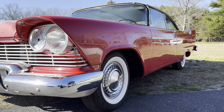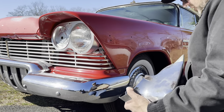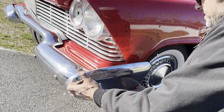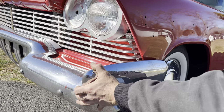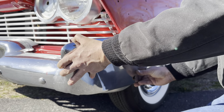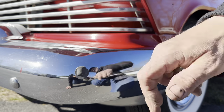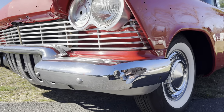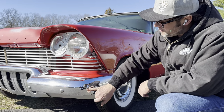Now that you have your putty established in the location of the bolt, approach the car with the wing and be sure to align the carriage bolt opening of the wing with the bumper. I like to kind of set them on there, confirm it's aligned, and then bring the wing on and push it into place. That's the install position of the wing on the bumper. When you remove it, the putty stays behind and you can see the mark of the square carriage bolt.